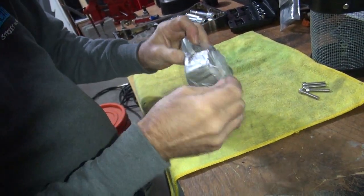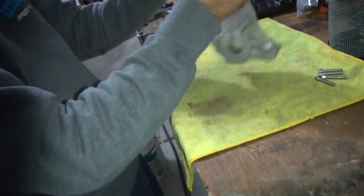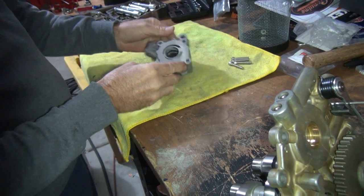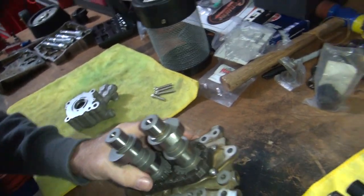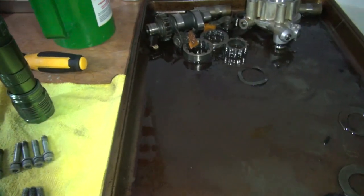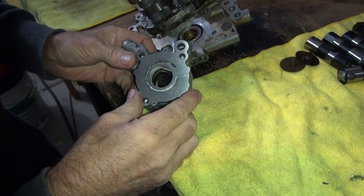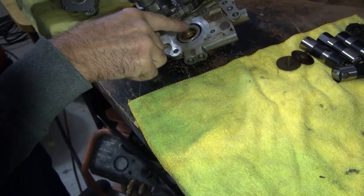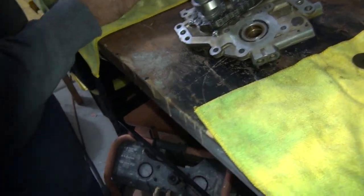This is not sealing compound — you're not supposed to put this in the motor. So what's nice about this pump is, see those wear marks right there? From those nasty gears over there? They've got a whole plate there — a wear plate. Gears don't run on the plate no more. Nice. So if this is damaged, you can JB weld it, smooth it out, and put this on there and it'll be perfect. Sweet. Save the cam plate.